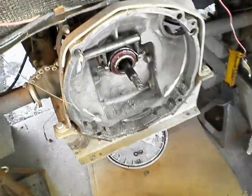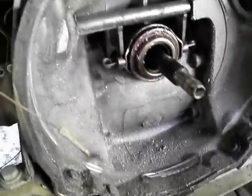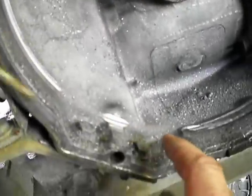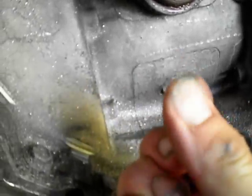But now I'm finding something a little bit disturbing. It looks like the flywheel of the starter gear has been rubbing quite a bit in here. There's a really deep groove there — you can see it all up there. Big old groove from the flywheel gear. Very strange, all around. I don't know why that would be, but it doesn't seem right. And it's all full of metal filings in there, all kinds of shavings.